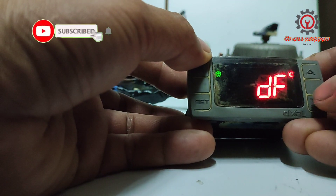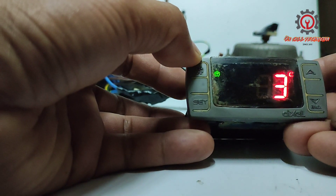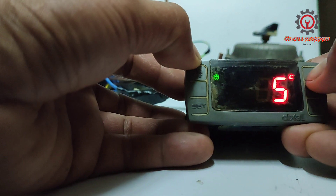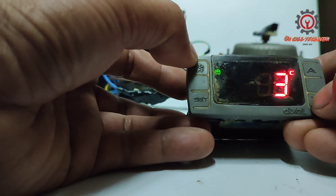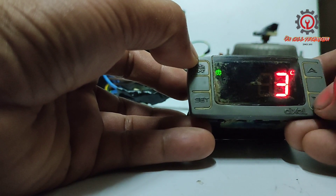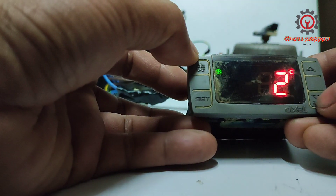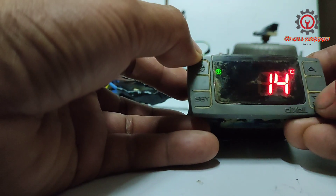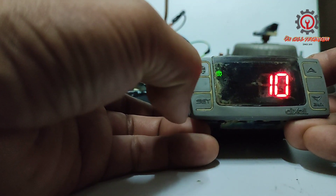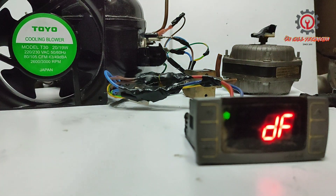If you want, you can use 15 minutes for the MDF, but make sure the IDF is set to three hours — never leave it at the default six hours. You may also use every two hours for the IDF if your MDF is 10 minutes. The purpose is to eliminate frost accumulated during a faulty sensor. Thanks for watching.